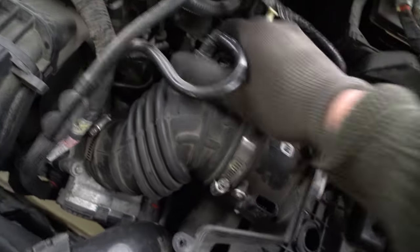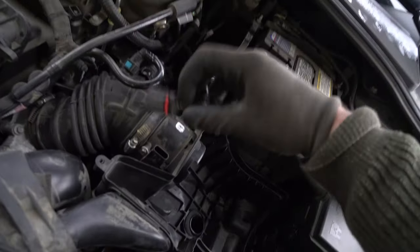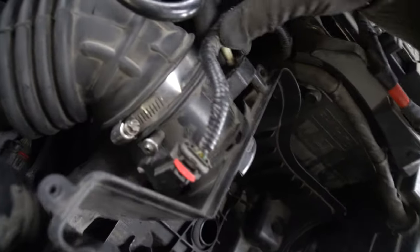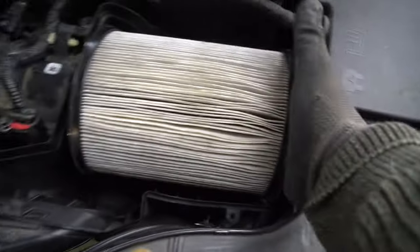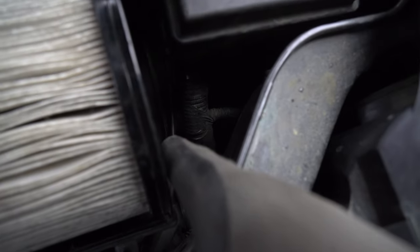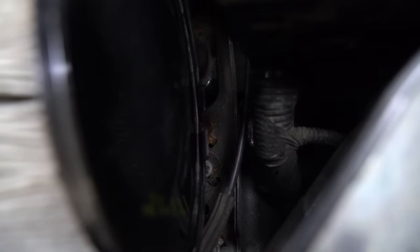After it sinks, just make sure it locks in — it should slide back into that position. This is locked in, perfect. Next, make sure you put your throttle sensor back on there. Time for the air filter — it goes in like that, then get your hand back here and keep pressing until it flexes around those two clips right there, then slip it down — those two clips hold it sealed in right down there.